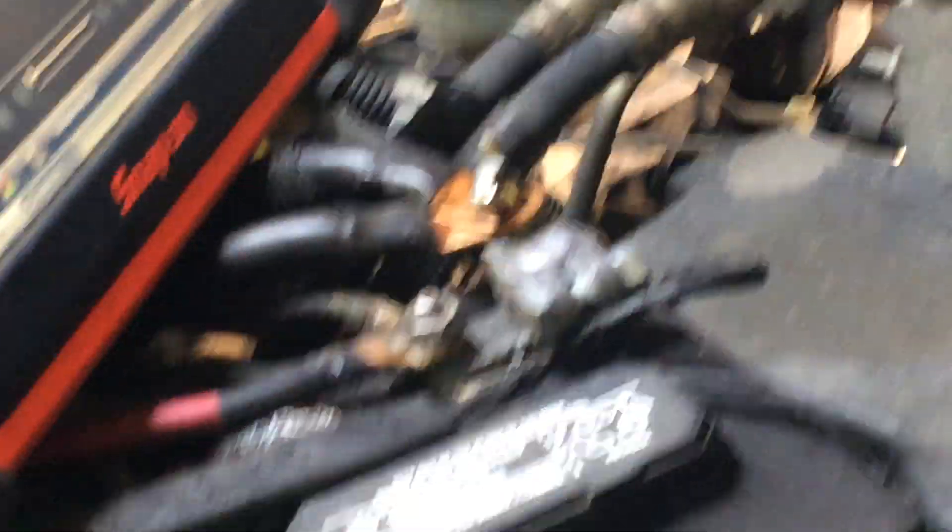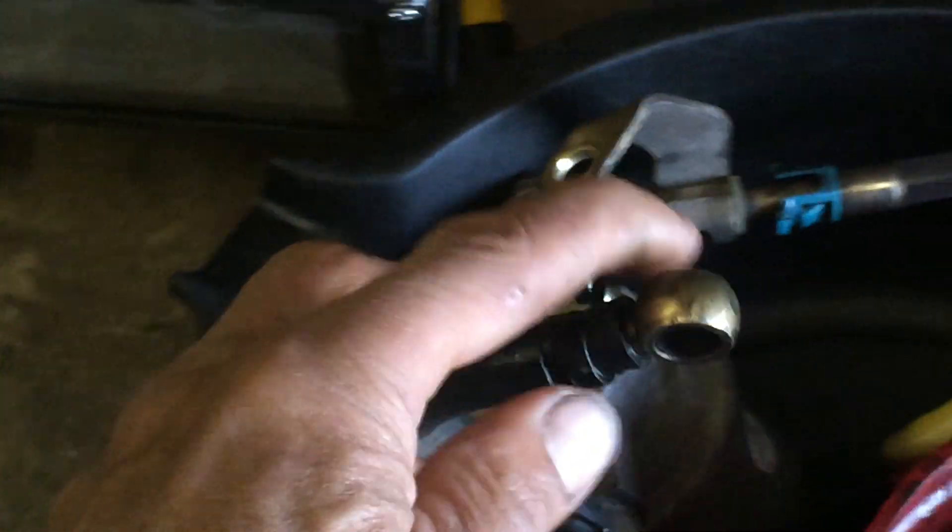Anyway, what we've done to further test the pump: the pump did not come on with voltage. We had no pressure on the Schrader valve at the fuel filter assembly down here, which I've already removed along with the fuel pump. We had no fuel pressure here connected to the fuel bowl.